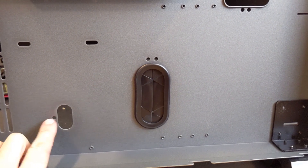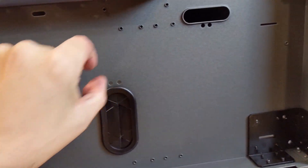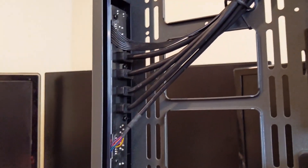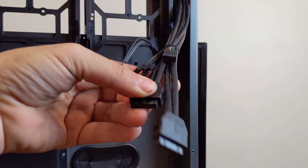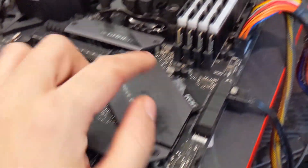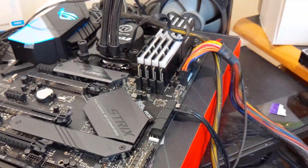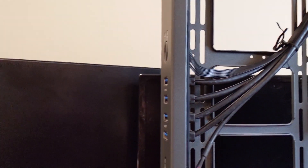I am going to do some real cable management. There are no cable tie points back here, so I'm going to get those sticky ones you can stick wherever you want, and once I get routing sorted out I'll have them run. The cables for the front are extremely long — they're zip-tied in place and come all the way down here. It's got dual USB 3 connectors. One difference is that this motherboard has a USB 3 and a USB 3.1 Gen 2, so I wouldn't need an adapter.